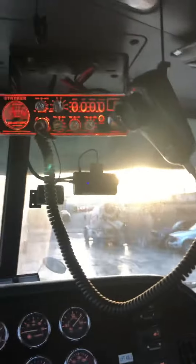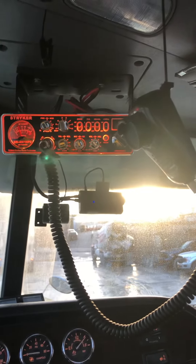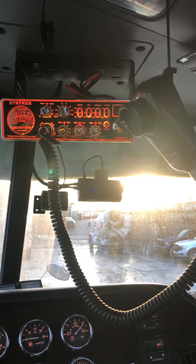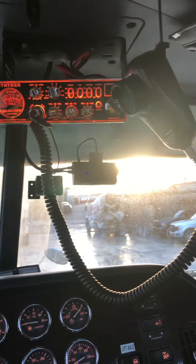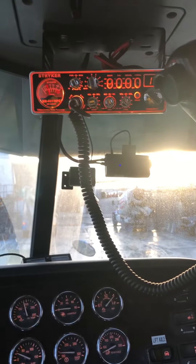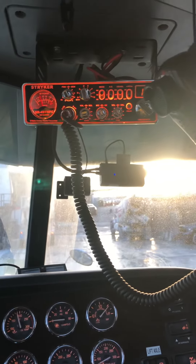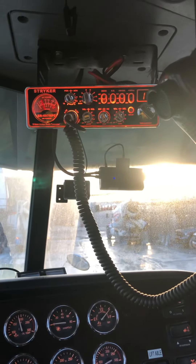With this setup here I've gotten out about 40 miles, and I'm sure I can get out a bit more. Also, if you're going to be running your own CB, get your own coax. Good coax is real important. I run a Wilson coax. I know some people say there's better stuff out there, but anything's better than what comes in these trucks, because the stuff that comes in these trucks is garbage.